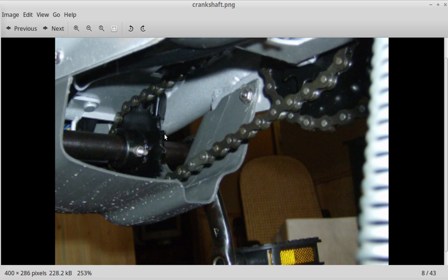And these are the teeth that I'm talking about right here. These may be bent and you just bend them back. And you got another two sprockets back here as well. So these teeth back here, some people, if the chain is tightened and for some reason it got thrown off and people put the chain back on while it's still really tight, they may do it in such a way that it bends these teeth. So just make sure that you don't have any of those teeth that are bent.